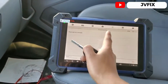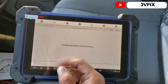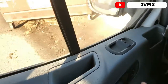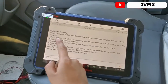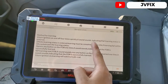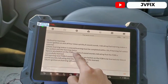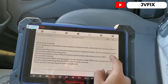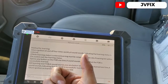So we're going to use the scanner. We'll open the ignition switch and go to program remote. It will give you directions — you need to make sure the vehicle is unlocked, so hit Unlock, press OK. It will say: turn ignition on and off four times quickly. You'll hear a sound indicating that the learning mode has been entered. Once entered, the learning must be completed within 10 seconds or it will fail.